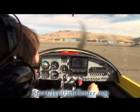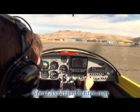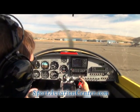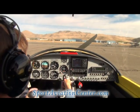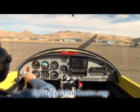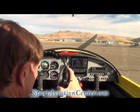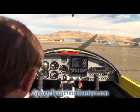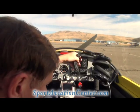Okay, so we're going to do our shut off, strobes, boost pump. I'll keep our radio on so we can hear. Mixture full rich. Flaps up. Key off. We're going to look at our Hobbs time. Master off. Key out. Key in the pocket here.